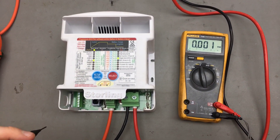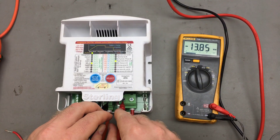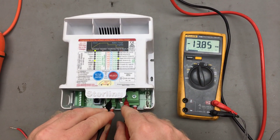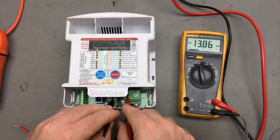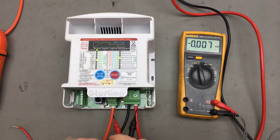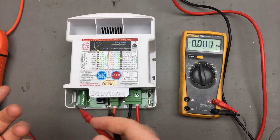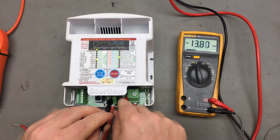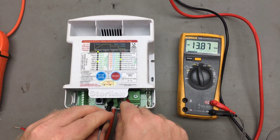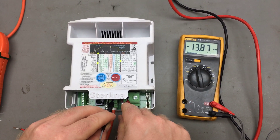This particular setup is absolutely fine for anything older than Euro 5 vehicles, where your alternator will be above 13.5 volts and below about 15 volts. However, from late Euro 5, Euro 6 vehicles and younger, what you'll find is that your input voltage here may not be as high as 14 volts — it may be way down to about 12 volts when you start up.